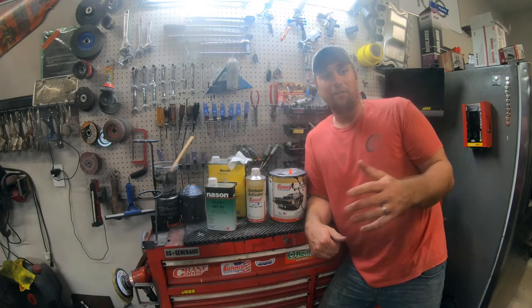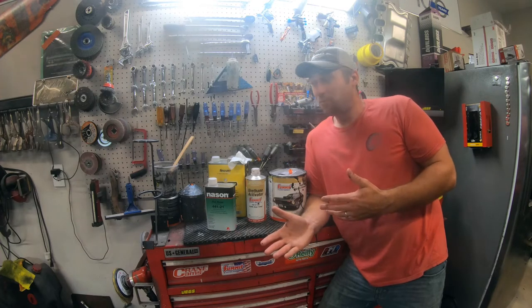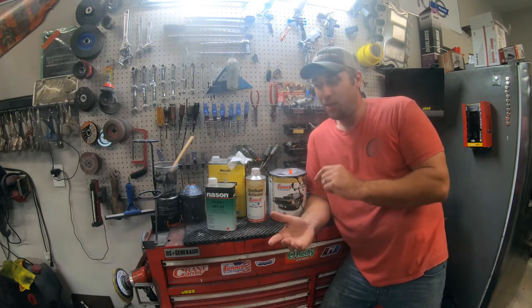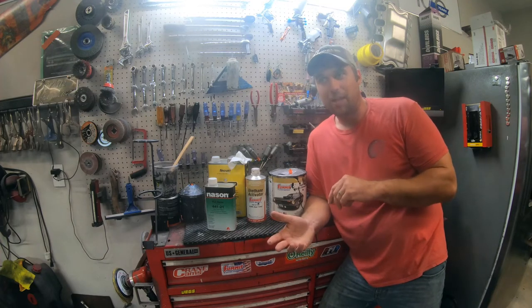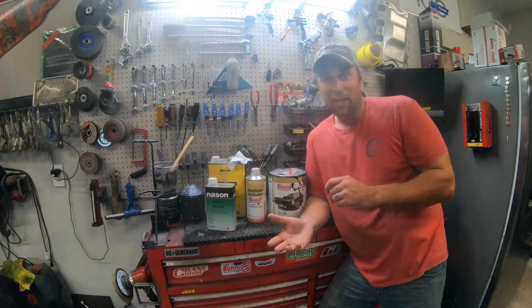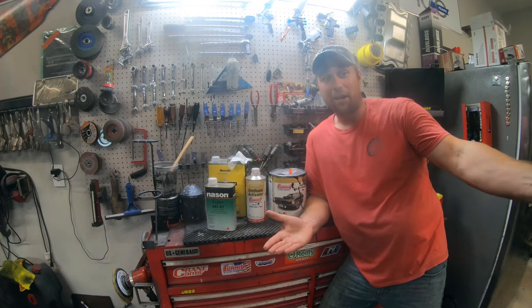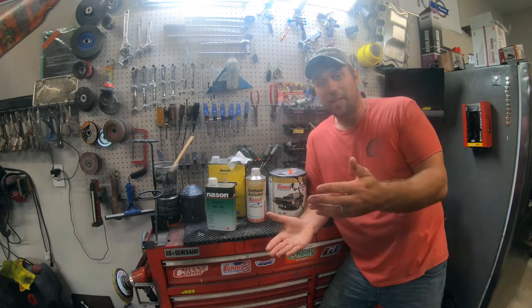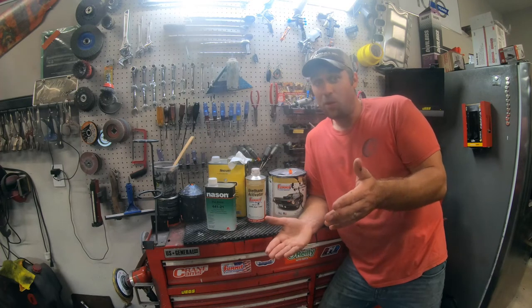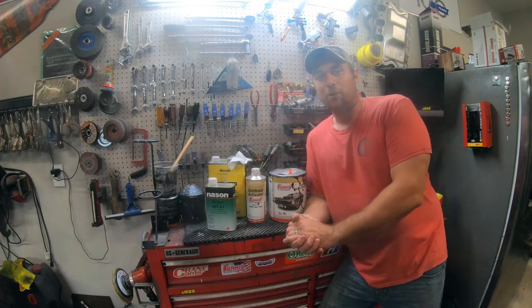So you need to be aware of your surroundings and spend a lot of time working with your own equipment, your gun, your air compressor, your air supply, your regulator. Get your PSI right. You know, 3 bars or 30 PSI at a paint booth may get you great results there, but your air compressor may not be able to keep up with that with a 1.3 tip. You may want to have a 1.0 tip, or a 1.1 or a 1.2. Those are all things you may want to try.